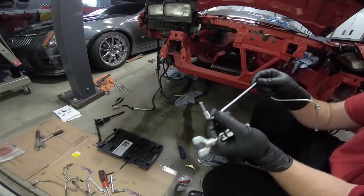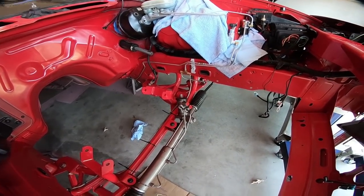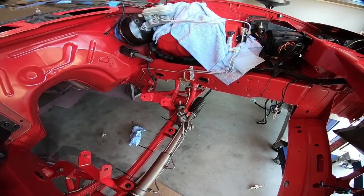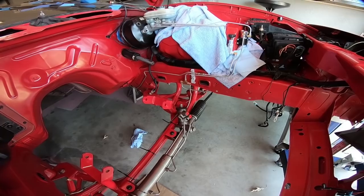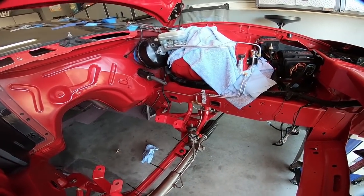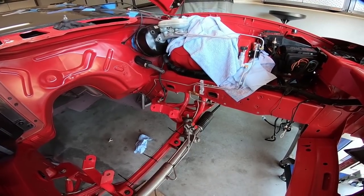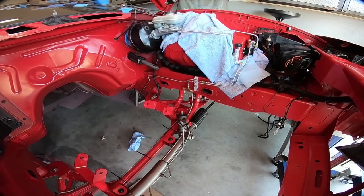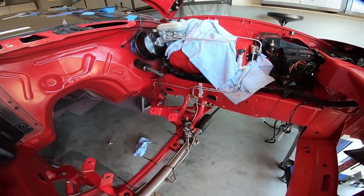We have it all hooked up. I didn't show you the flaring of the brake lines in the car — I ended up taking them back off and flaring them outside of the vehicle; it was just way easier, except for the one that goes to the back which I had to flare in the car. You can do a decent flare job with the cheaper kits if you take your time. I'd love to have an Eastwood brake flaring tool, but I don't. All in all it looks pretty good. I still have the towels there — I have not bled the system yet, which will be my next step. I'm going to have to unhook the brake line in the back, which we'll talk about in a future video. I'm going to bleed the lines and then wrap each joint with a paper towel to make sure there are no leaks. I'm also not going to worry about the wiring because we have other stuff to get accomplished before I go on to wiring the line lock switch inside the vehicle.